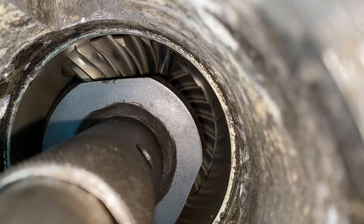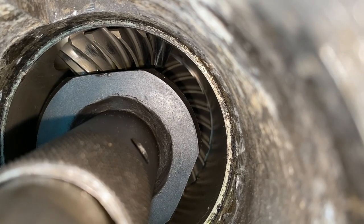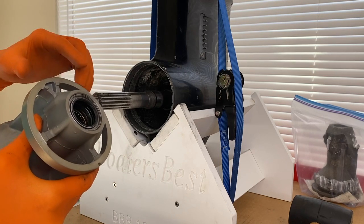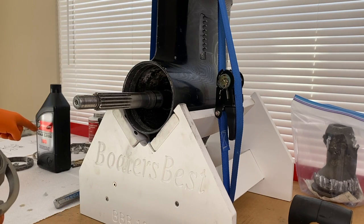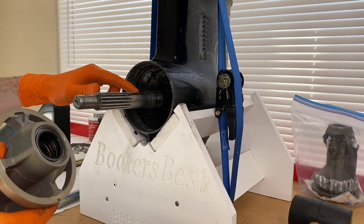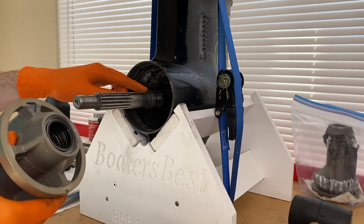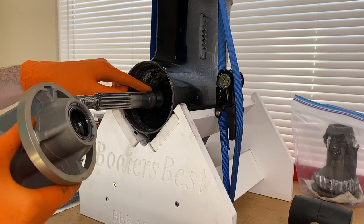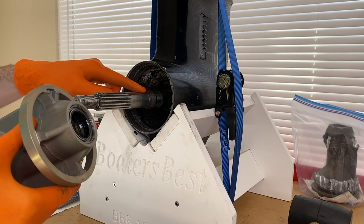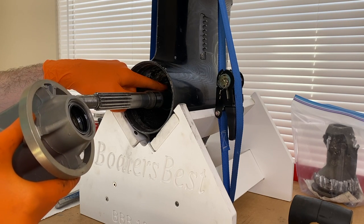It's important to ever so slightly adjust the drive shaft to align that pinion gear nut in a position where you can efficiently slide that tool in place and lock that nut and gear as well as shaft. Next, I grabbed our brand new bearing carrier and lubricated the internal oil seals with the same gear lube. That will come in handy because this propeller shaft gets to a point where it bevels up and is larger in diameter.